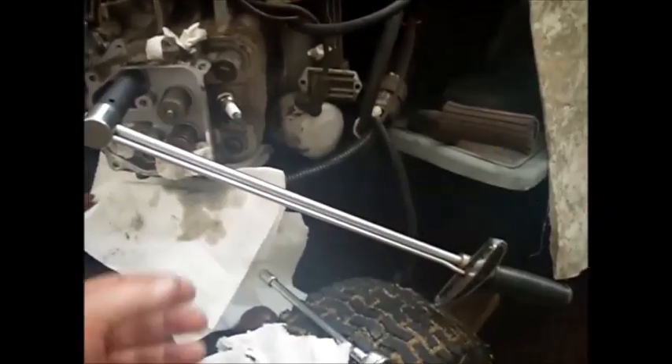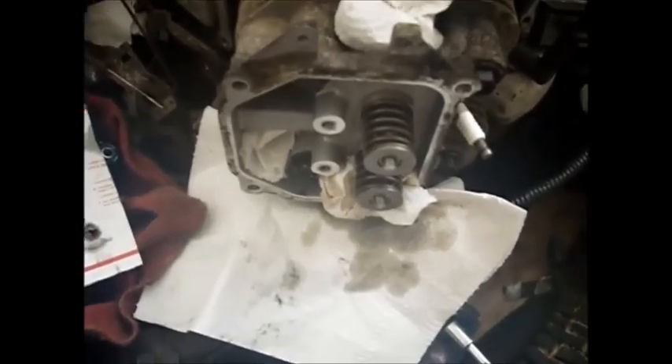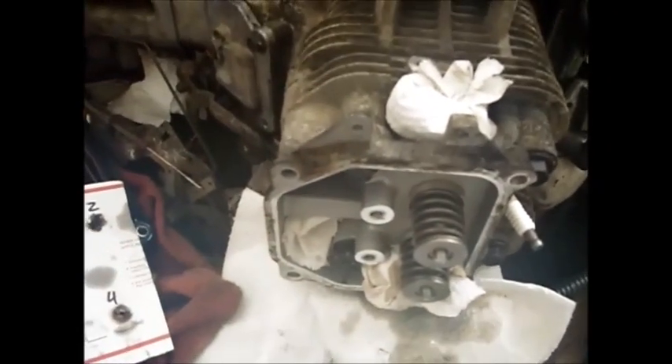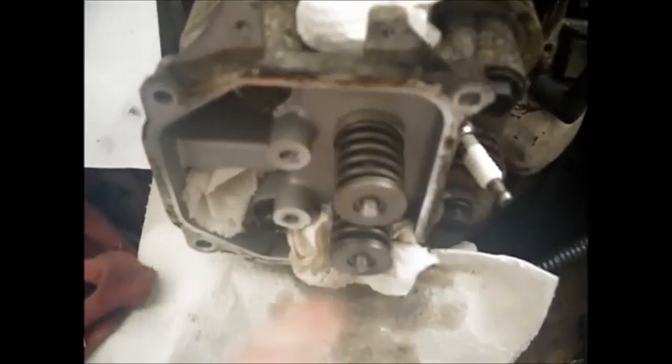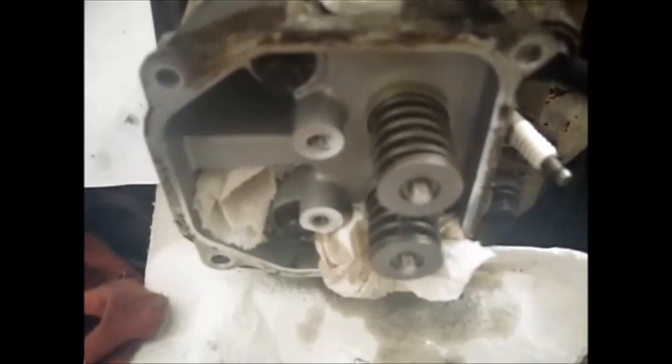I've got my father's old torque wrench - old style. So I'm gonna break this head loose and put the bolts into a pattern here. A little thing I do when I break these head bolts loose - I look at the sequence they were tightened. In this case, you've got to rotate this page from Kohler to get the right direction on your bolts. But I loosen them in the same way - the sequence pattern they use for tightening, I just reverse that. I do it on every engine I ever take apart.